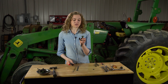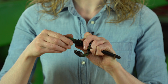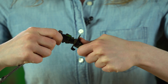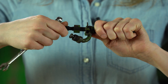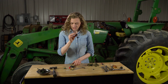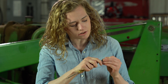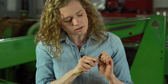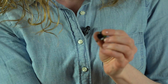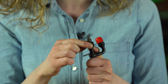We're ready to prepare the new injectors to go into the tractor, so you need to do some disassembly on your old injector. This is the very top for the return line. I'm going to take that off. What we're trying to do is to salvage this nut. I'm going to slide this nut down a little bit and use a wrench to remove the very top of the injector. It doesn't matter on the old injector that I pull this apart since we're not using it anymore, but I would never pull the top off of my new injector. So now I have my new nut here, and I'm just going to use a pick to get this little rubber spacer or washer out of there. I have brand new spacers to go in there next.